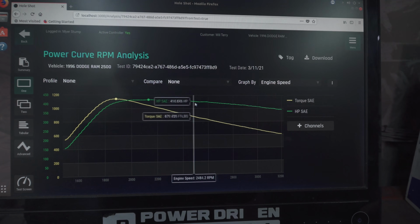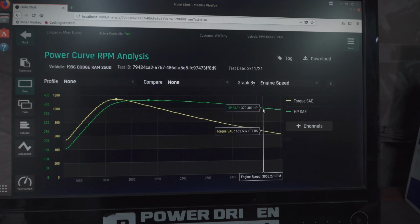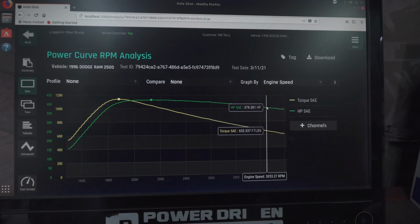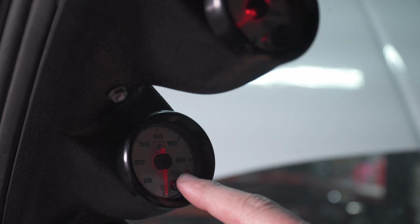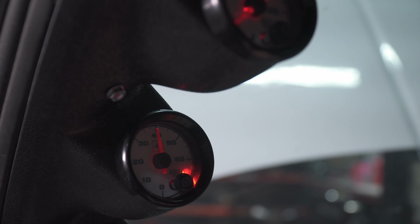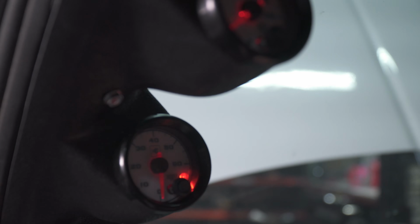Just heat soak, out of turbo, maybe choking on the turbine flow. Did the boost drop as it kept going up? Absolutely dropped. It peaked at about 40. Let me turn it on here. Let's see peak boost. This is the boost recall. I swear I hit 40 that run. 39, 38, 39. But again, by the end of the run, it was 31, 32.